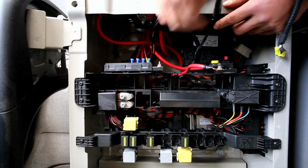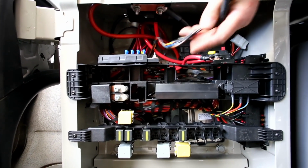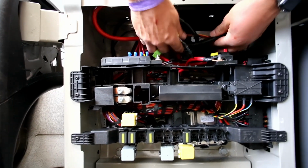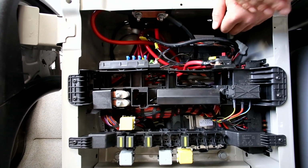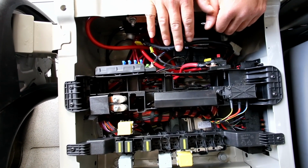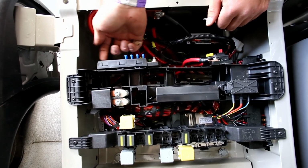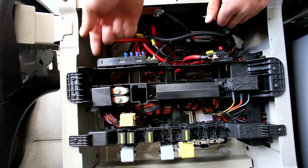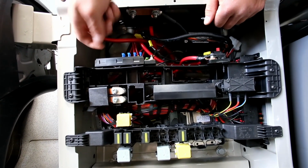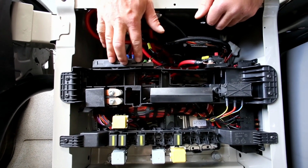You want to make sure that your wires for your seats are free to move. Set right back up on top so that you can plug your seats in easily. But we are now done with the battery system. It's all installed. And again, if you have extra circuits, you're plugging them into these other sides of the fuse block. And you can always just reattach and continue to plug into here for more circuits that you need, as long as you don't go over 100 amps.